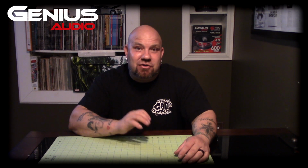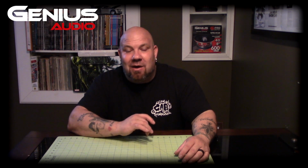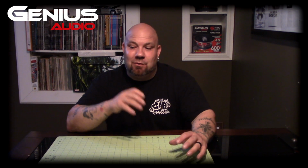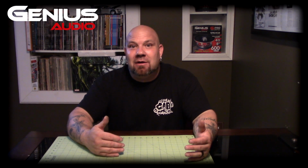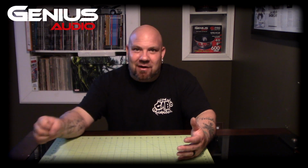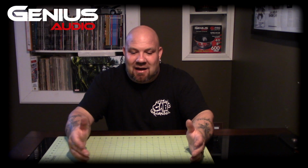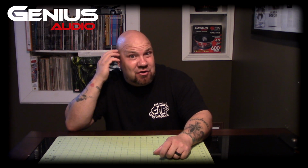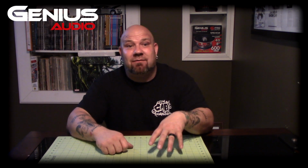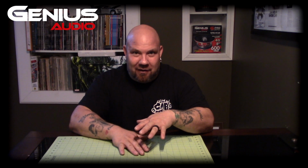It does require two 0 gauge power inputs and two 0 gauge ground inputs. So you have to figure that in when you're going to use an amp like that in your install. So it's not something you can just run, and you can't run a 0 gauge to a distribution block and then run 2 out. I mean, you can, I guess, if your run is that long, but outside of that, I wouldn't do that because you're going to overheat that first wire. It's going to catch on fire. That amp draws enough power that you can burn your car down.